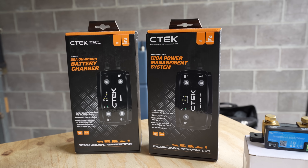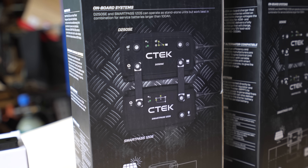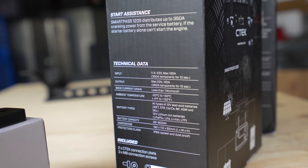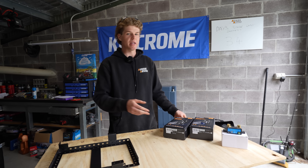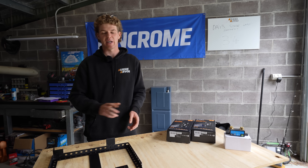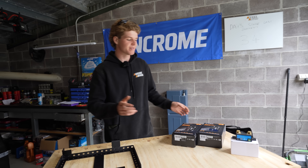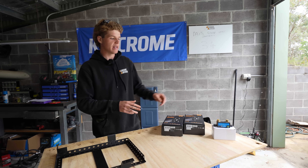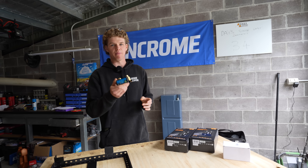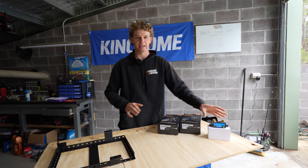These can actually be used individually, or in conjunction, which is what I'm going to be doing. When used together, it allows you to do all your smart charging at a very high rate — assuming your alternator and battery can handle it, these can charge up to 140 amps, which is pretty nuts. If you've got a low battery, chuck the car on charge for an hour — happy days. I'm also going to be using the Victron SmartShunt, which will allow me to monitor the current in and out of the battery off my phone, so we can see exactly what these things are doing once they're in the car.